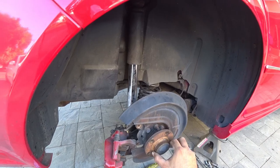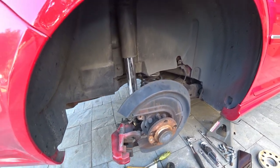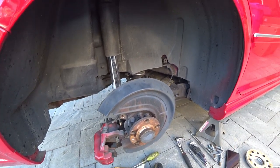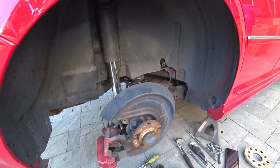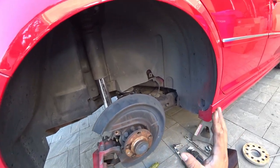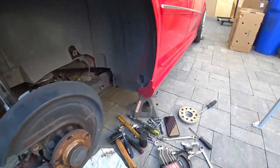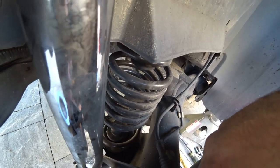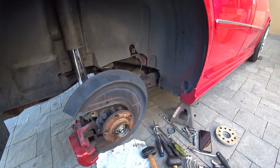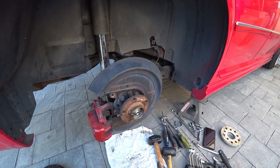Since we are replacing the hubs and the bearings on this, we're actually going to damage the bearing during removal. If you guys want to preserve the bearing, there's an older video on my channel — look up IDF drop plates — that walks you through how to do it without damaging the bearing. We're going to do it the proper way by putting new bearings and new hubs in here after we get the new drop plates installed. Next step is to remove the ABS sensor using a 5mm Allen wrench. Then take the dust cap off using a flathead screwdriver.